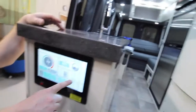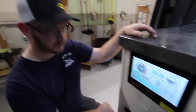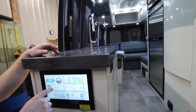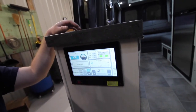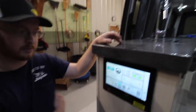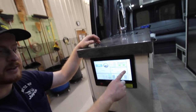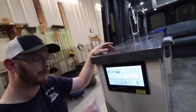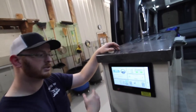You can see that it says 'gen' for your AC source, indicating the generator is powering the unit. You can also see the electric readout at this spot — you can see all your amps. Now we have 36 amps of input into our 12-volt system. We have three sources of AC power: the generator, the inverter, and shore power. Shore power is the plug on the outside; the inverter is the box underneath that takes 12-volt to 120V; and the generator takes propane motor inertia to produce 120 volts.